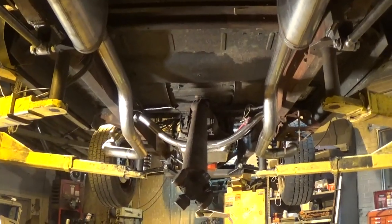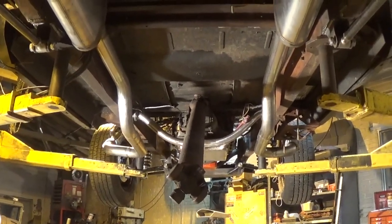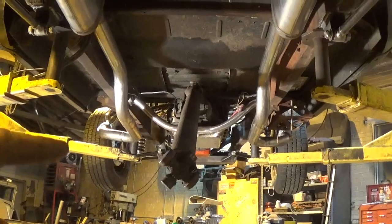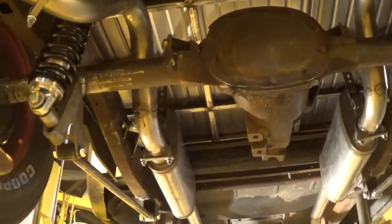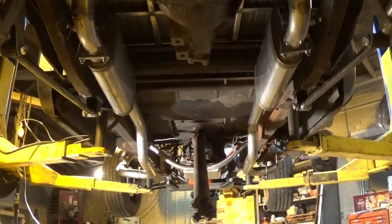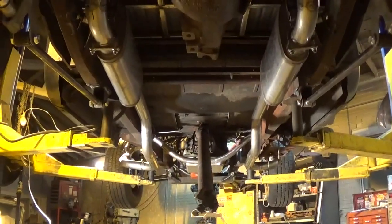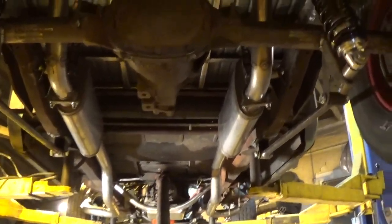If you were going to buy this kit and you don't have access to a welder and wanted to clamp everything on your vehicle - I'll say this much: if you had headers that came out underneath and came straight back, and you had a leaf spring style rear suspension where a four-link wasn't in the way, and obviously I got my fuel cell hanging down in the back too - I think if you had a leaf spring truck you could get away with clamping this entire kit on the car and it would work just fine. Just trim the pipe down, clamp it where the flares and expansions are, and it would work. But in most cases you're probably going to need a welder to put this thing together to make it right. On the plus side there's plenty of pipe - I had everything I needed.